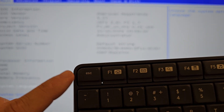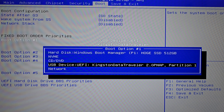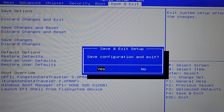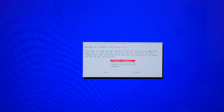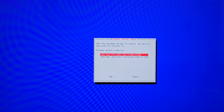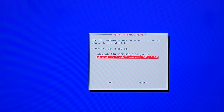For this I need to change a setting in BIOS to allow the PC to boot from USB. Hook it up to your TV and start the mini PC. The moment you see the Ace Magic boot logo, press Escape to enter BIOS. Navigate to Boot, scroll down to Boot Option 1, and select the USB device with UEFI — this is where the bootable LibreELEC image is. I've restarted the PC and now we should boot into the LibreELEC setup.